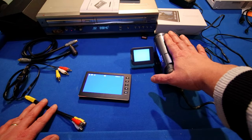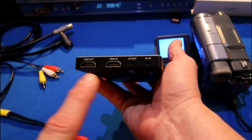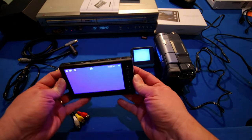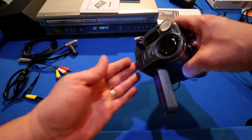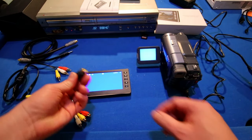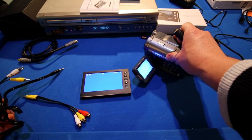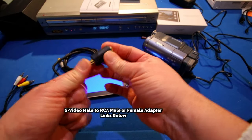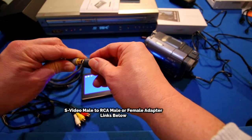I'm going to show you how to record from your camcorder into this HD box. Now this box has an HDMI in and out and an AV in and AV out — that's all it has. This is an HD recorder. To record from this device, which is much smaller and an older system, you're going to need some additional components. In my case, this camcorder doesn't work with its video out for some reason, so I have to use the S-video. I had to purchase an additional adapter to plug into my S-video port.